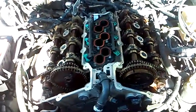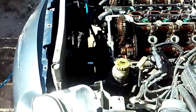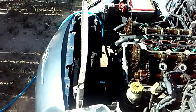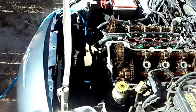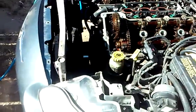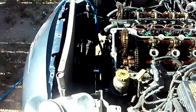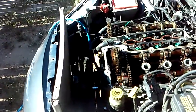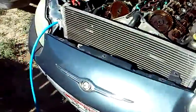Removing harmonic balancers can sometimes be tricky — pretty much all harmonic balancers, regardless of make or model from Nissan to Ford, are torqued on pretty well. A lot of Hondas require around 125 foot-pounds of torque, some bigger engines require more — as much as two to three hundred pounds of torque. I've had harmonic balancers take me as long as two or three days just to get off.